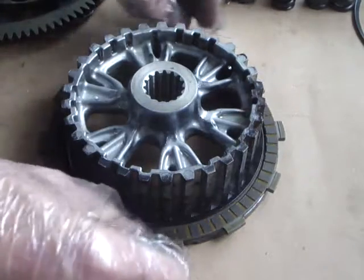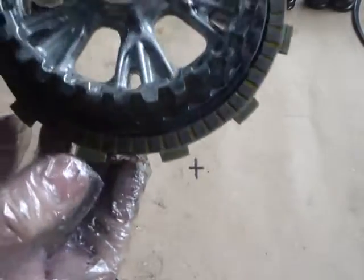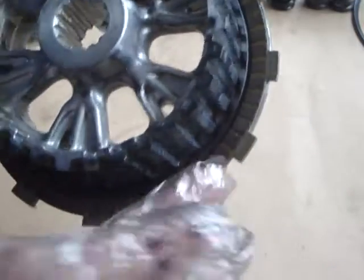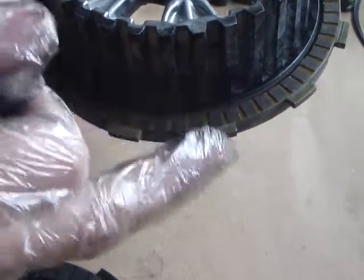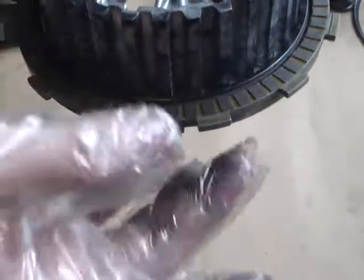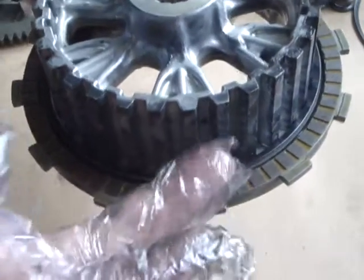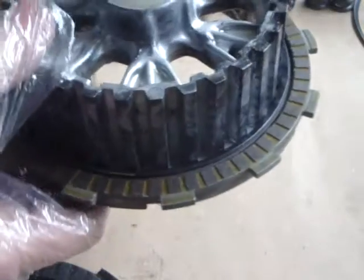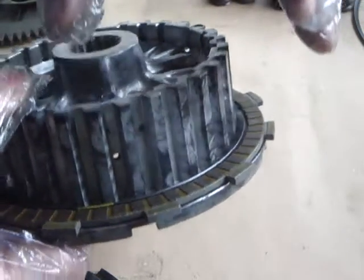This clutch plate goes round the outside. This spring is actually just standing proud of the face of the clutch plate, and this is the anti-judder spring. As the pressure plate compresses the whole pack of plates together, this spring stops the last plate being finally nipped up. The fact that this is missing is probably the cause of the owner's very late clutch bite point and a very short clutch bite point at the lever as well.